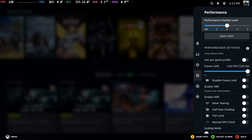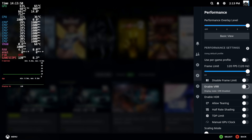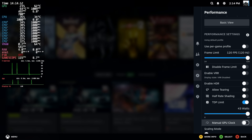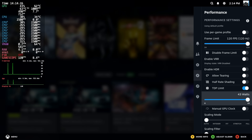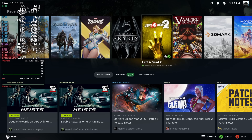We can open the performance overlay and bring it all the way up. On the left-hand side you can see the wattage for the GPU, but CPU wattage isn't listed with this Lenovo for some odd reason. I'm connected to a 120 Hz monitor and we can disable the frame limit, enable VRR, and HDR as long as your display supports it. When it comes to TDP limit, we can go up to 43 watts inside SteamOS with no third-party applications — just like you would adjust the Steam Deck. Manual GPU clock is unavailable with the RX 6400, which I kind of expected. And 43 watts might not sound like a lot, but we've got the T variant — a lower wattage chip — with six cores, 12 threads, and a pretty decent boost clock. I haven't seen it hit 4.6 GHz yet while gaming.